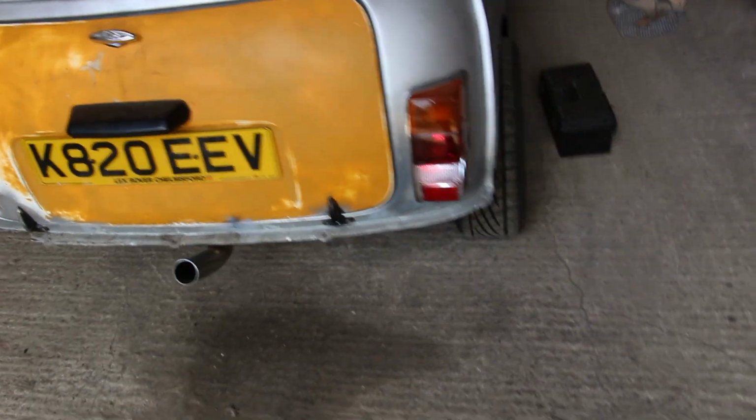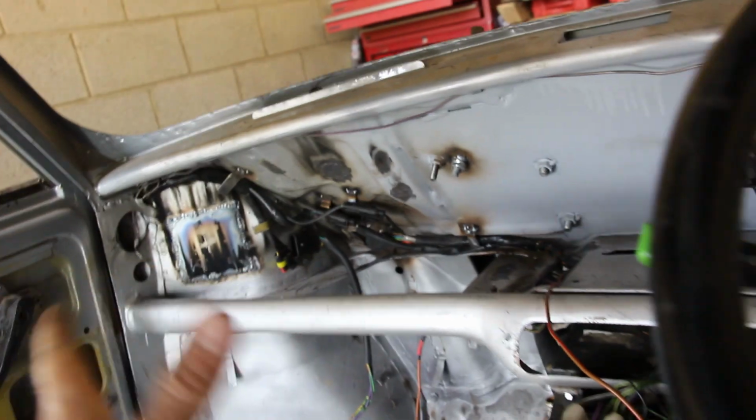Fog light on. I'm going to show you, just so you don't think I'm lying. I've got reverse and fog there, so it's a bit blurred, but sides, all a bit dull. Battery's probably dead, all my wiring's rubbish, but it's all good, all works. And what that means now, let's take off the power so we don't melt stuff, is all my Mini wiring works. The two plugs at the bulkhead work, the plugs that go to the rear work. One thing we haven't tested, interior light, so we better fix that problem.